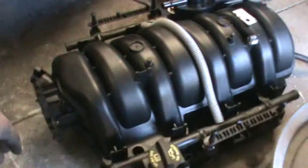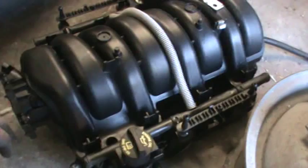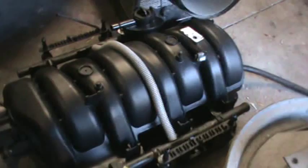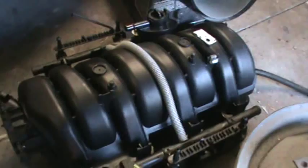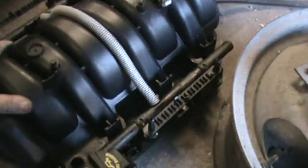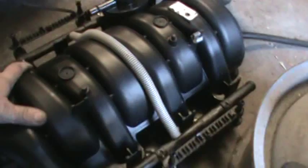We just want this to be completely safe, so we'll go with a new manifold. The last thing you want is contamination from the intake manifold destroying your new heads. My buddy Ron had a head shop, and last time I was there he did a Mitsubishi head for a guy. The mechanic put it on, they fired it up, and pieces out of the intake manifold went into the cylinder head — it looked like a ball bearing got loose in the motor and destroyed it. The intake manifold is the nesting place for all that debris that comes out of the cylinder head. Sometimes you can access it, and sometimes you just can't get to it. These manifolds are very hard to clean — they have sections that just dump into the plenum and runners that dump into a floor you can't access.